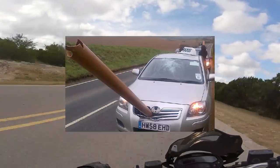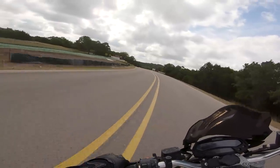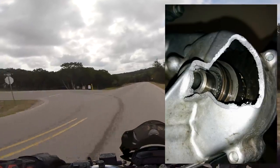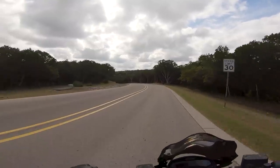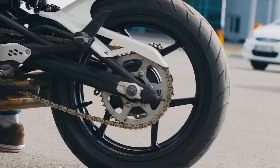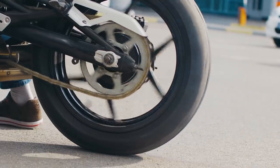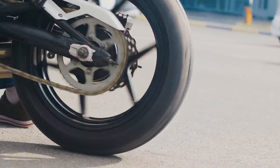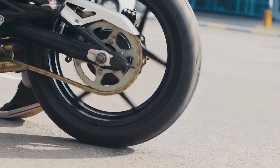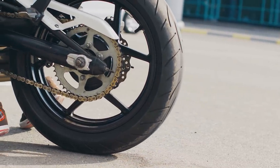There are two ways a chain failure can go down. The first and more lucky is that it snaps and shoots the chain out the back of the bike at Mach 1 into the radiator of the car behind you. Or it'll snap and shoot the chain into the engine case, busting a solid engine-killing hole in the bottom of your transmission, likely ganking up all the gear dogs and messing with the top end too. Early symptoms include driveline lash — where parts of your chain are at different tensions causing uneven speed — or a lot of side-to-side play, or the chain bunching up in certain parts. If you notice any of that, just pay for a fresh chain and save yourself the headache.